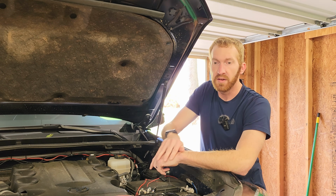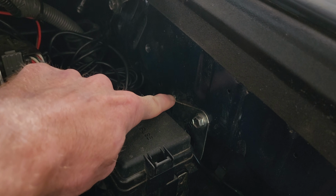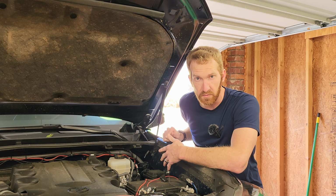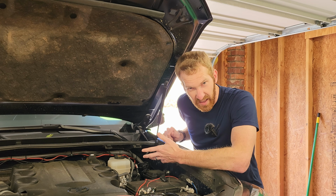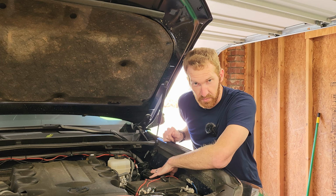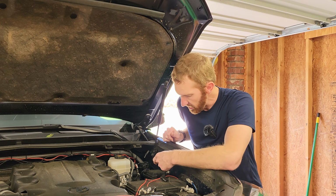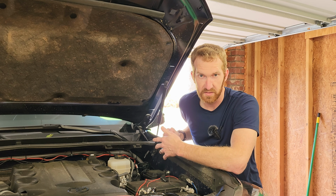To get this mounted in the 4Runner, I need to take this fuse relay piece out of the way so I can adjust this bracket. And by adjust, I mean modify with a die grinder. Not all 4Runners have this. Mine's a TRD Off-Road. My friend has a 2017 TRD Off-Road, and hers does not have this fuse relay, so I don't know when they added it. Maybe you could tell me in the comments. I don't need to modify the fuse relay box to be clear. I need to cut this bracket where that hook goes in that hole. The tray will use those two threaded holes by Toyota, and then that bolt will hold that bracket there. It doesn't need a lot of bolts. It's just a fuse relay box. One bolt will be just fine.